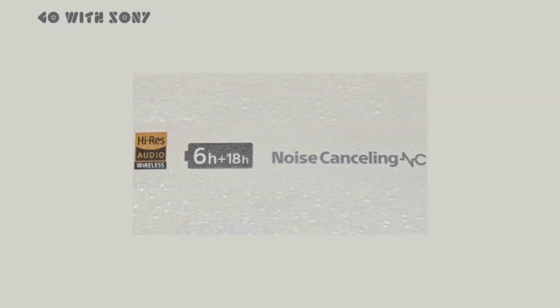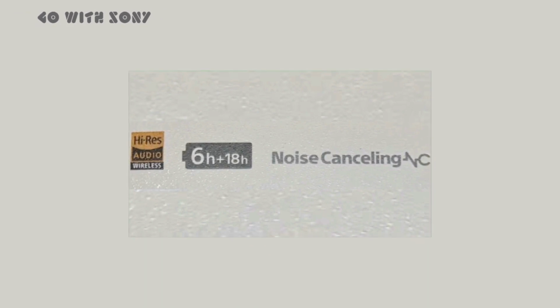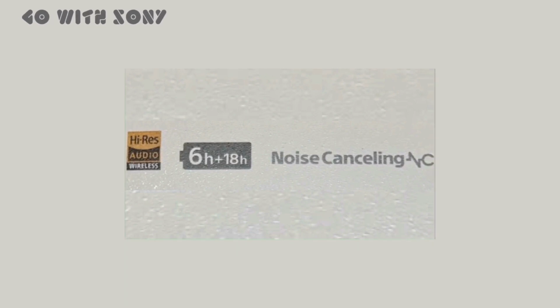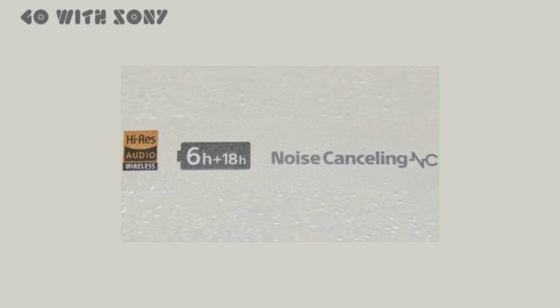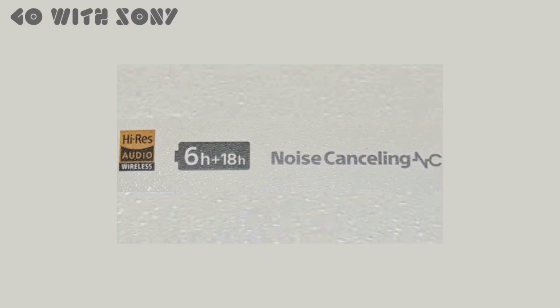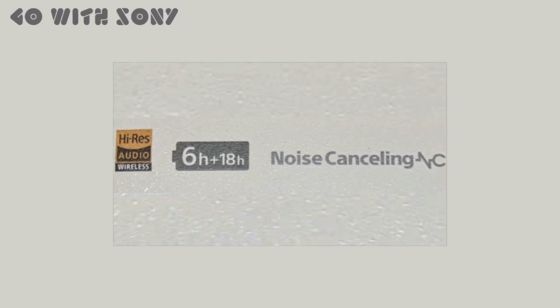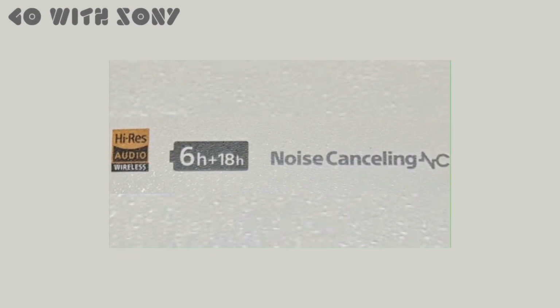The Sony product page notes the 30 hours is with NC on. So this means the 30-hour battery symbol is for AAC. If we look at LDAC with NC on, then that drops down to 24 hours. The drop of 6 hours is pretty significant, and I wonder if decent playback with LDAC will be possible on the WF-1000XM4. But then the WH-1000XM4 are much larger headphones, so perhaps not directly comparable to the